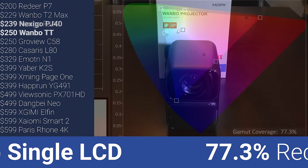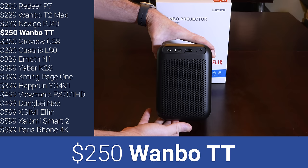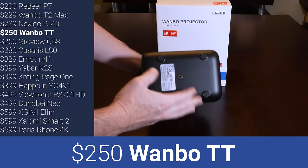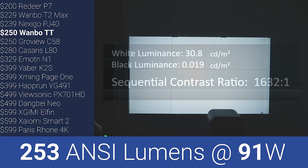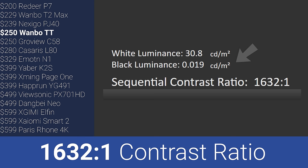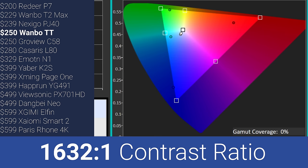The PJ40 also had significantly better SDR color space coverage at 77.3%, putting it in the lead for all three categories. Next, for $250, is the 1080p single LCD Wanbo TT, which is similar in size and weight to the lower priced Wanbo T2 Max. But unfortunately, the higher price doesn't get it any closer to Wanbo's claimed brightness, outputting just 253 ANSI lumens, which is less than 40% of its advertised 650 lumens. The Wanbo TT did have a significantly lower black floor than the T2 Max at 0.019 nits, resulting in a respectable contrast ratio of 1,632:1, but it unfortunately had the worst color space coverage yet at just 57.8% for standard dynamic range content.